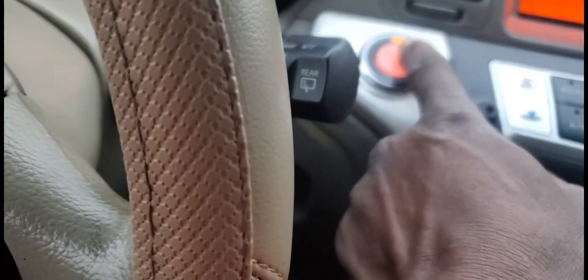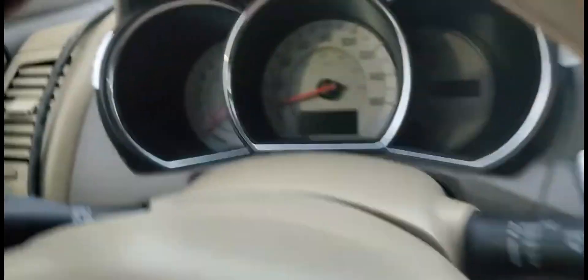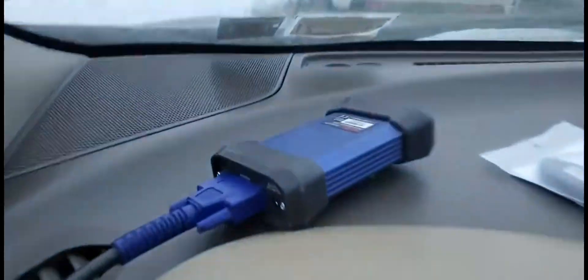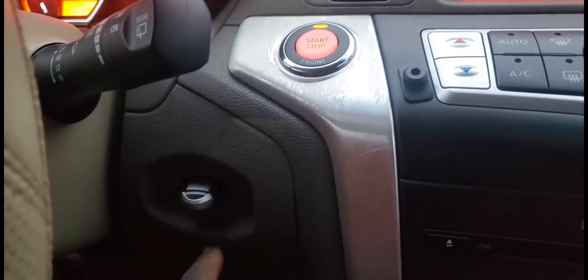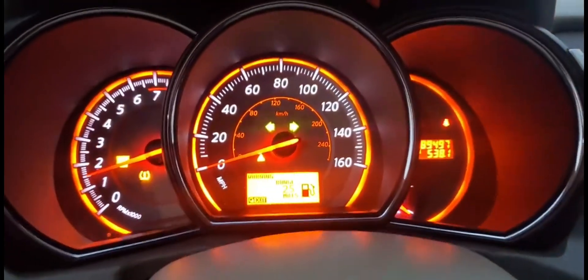Turn it on again. It's done. I'm going to take it out, push it again, push this door lock — unlock works. Now push this one. Because this one here, you always work with the remote. This is the first generation. I'm going to push the brake — my car starts. Everything is good and perfect. If you need to program more than one key, don't close it. Take it out, put the second key, the third key, the fourth key. After that, put the last one in and it will work. Right now everything is good. You are on the road. Your car is perfect.